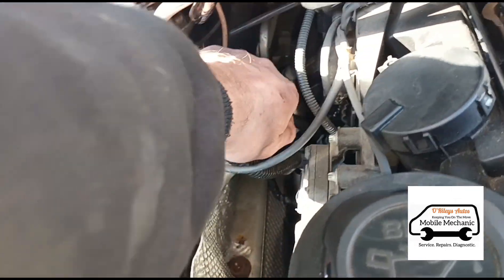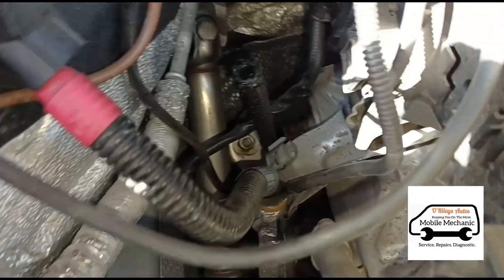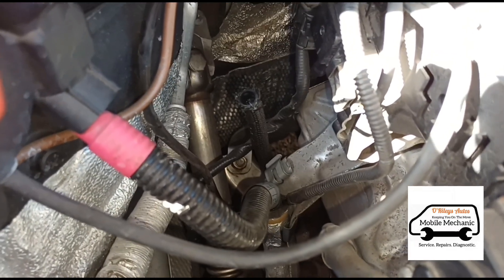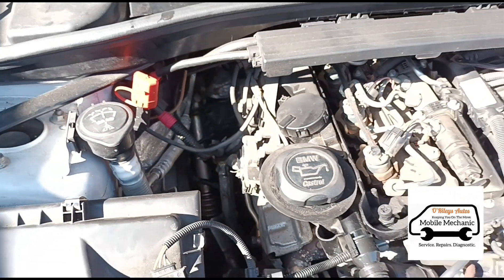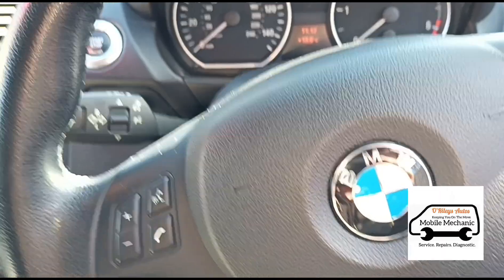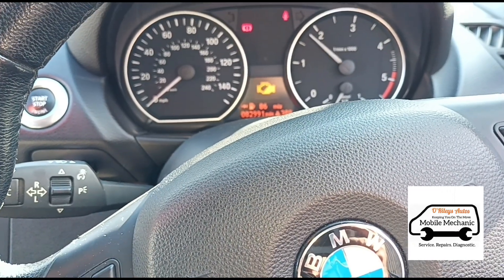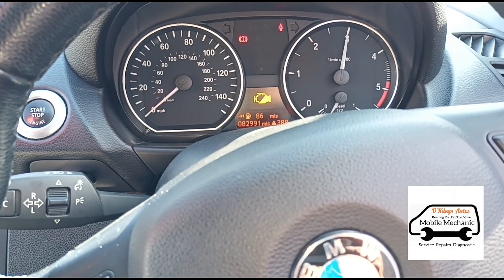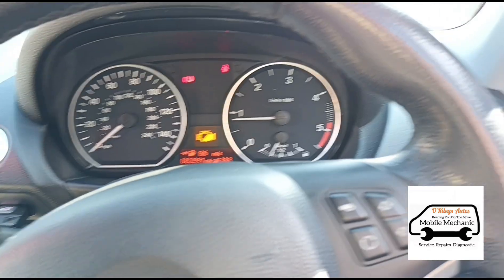Okay, we're back — we've let it sit for a while. I'm just going to remove that now. What I'm going to do is start the car, but I'm not going to connect the pipe back to the pressure sensor temporarily, just in case it pushes any of the fluid back up. We're going to start the car and then after a few seconds of running we can connect the pipe back up. Okay, we can come back outside and reconnect that.